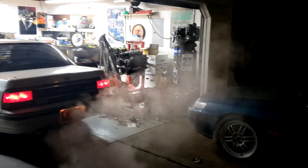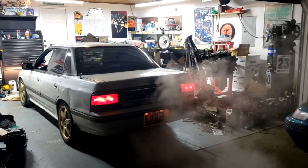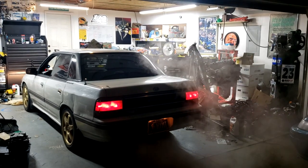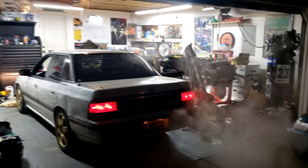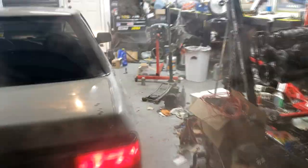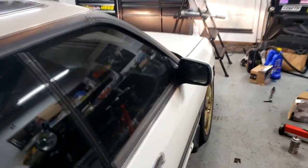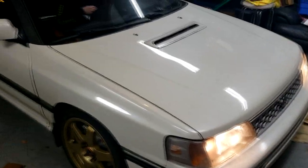But this is sort of what you kind of have to do when you're starting with a base map and it's not correct — you're going to have to drive the car and tweak certain things to get it to run better and keep it safe, assuming you have a wideband and all those things. So let's take this thing for a little drive. Obviously no boost or anything like that, just kind of drive it around and make some tweaks.